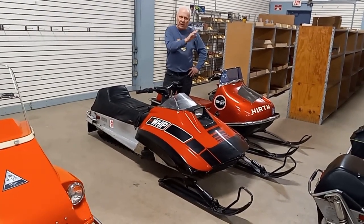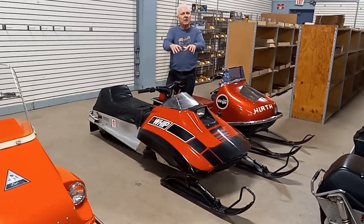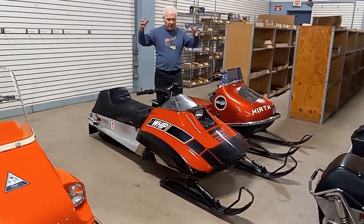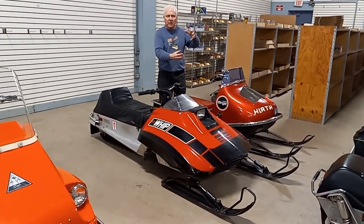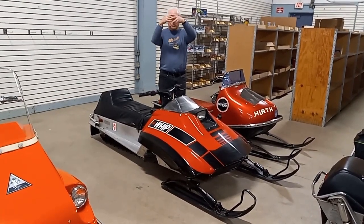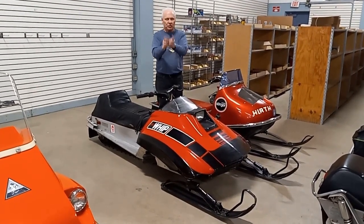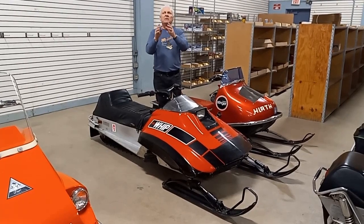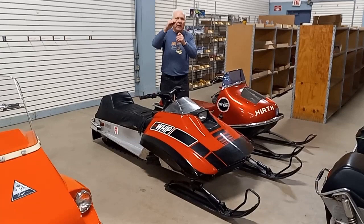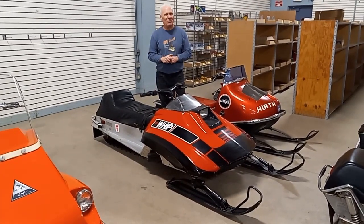Now, Skidoo had rotary valve motors at the time, but this is different than that disc that goes around. The concept with the bullwhip was to have a crankshaft that had large lobes on it, throw air and fuel into the crankcase, and this would blow up into the combustion chamber, bang, and you produce horsepower. The duration of that was extended by virtue of this unique motor. It required very tight tolerances between crankshaft, crankcase, and cylinder head. And therein lies the problem with the motor.